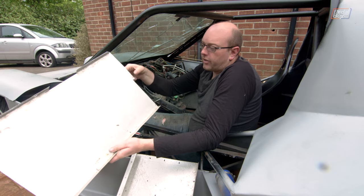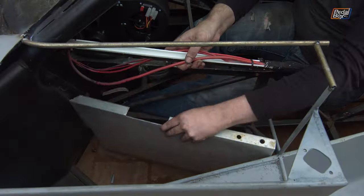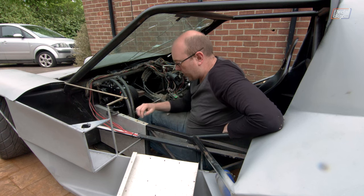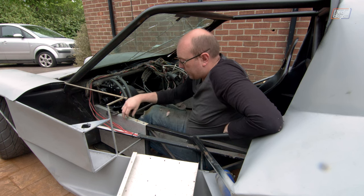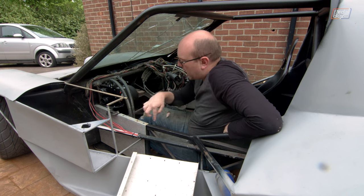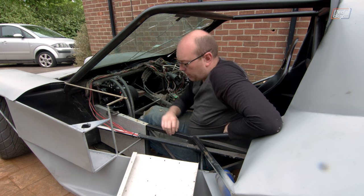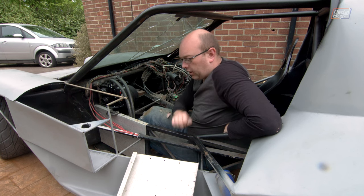For now we're going to get on with fitting these. The other relief on this is cut out of the front and it just fits in like this. The panel attaches onto the car and we're going to pop rivet through the outside rather than the inside, and tidy up this edge because it's currently just a little bit bigger where it would have wrapped over the top. We're going to trim this edge back before we firmly fix it in, and pop rivet the bottom in as well from this side rather than inside the cabin.